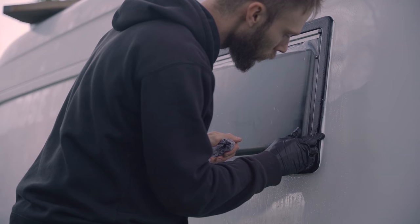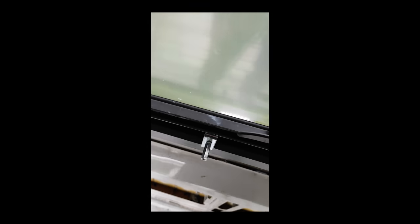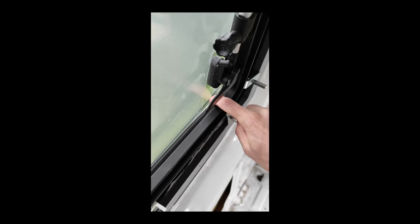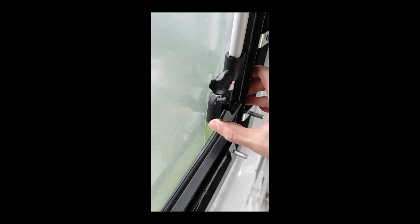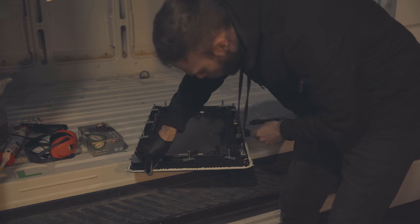For cleaning up the squeeze-out it's the same soapy water trick. After installing the window and playing with the latches I noticed a problem: on the left the seal is good and nice and tight, but on the right there's a gap in the corner. I can close it with the latch but there's a lot of bending force on it which I'm not a fan of. It was getting dark and I needed to decide whether to pull the window out and fix it or just live with it. I pulled it out. Nothing saves fun like cleaning sealant off in the dark.